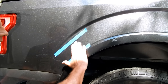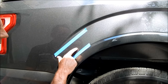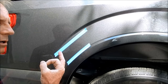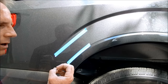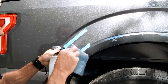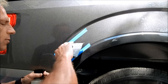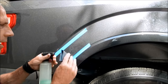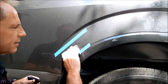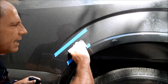For any beginner, removing sanding marks requires more aggressiveness than you'd think. I don't mean quantity of product, but aggressiveness of the compound. Even after taking it to 3000 grit, you might think the marks will come off so quickly — and they will — but you have to double-check to make sure they've all been removed.